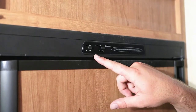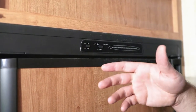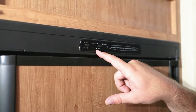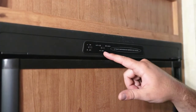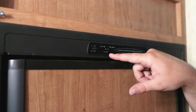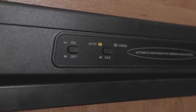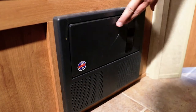The next thing you want to check is to be sure that your refrigerator is on. For our refrigerator, and a lot of them out there, the on/off switch has to be depressed, and then you either want auto or gas. This depends on whether you want it to switch over to gas when you're unplugged and then switch back to electric when you're plugged in. For our case, you would want it in the up position.